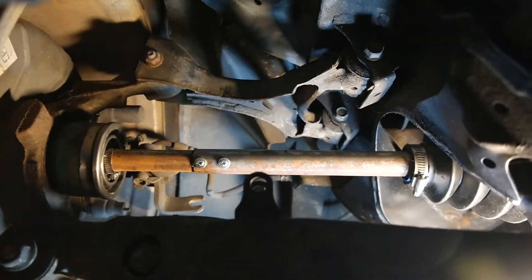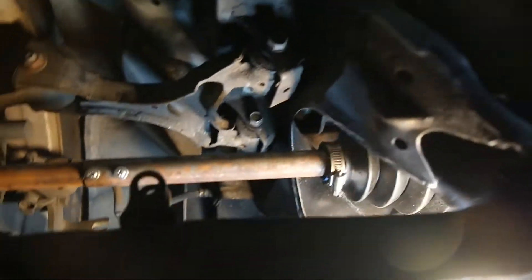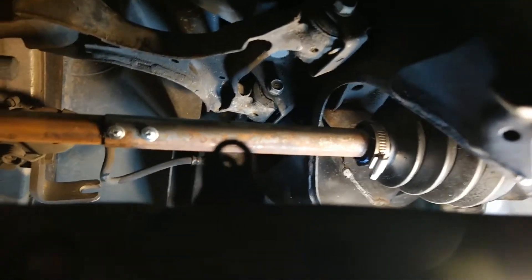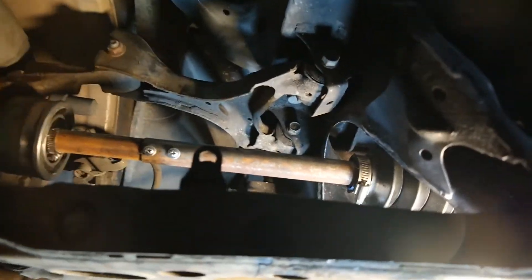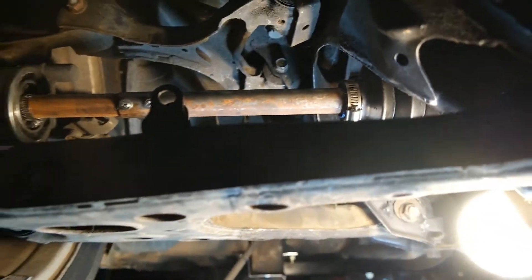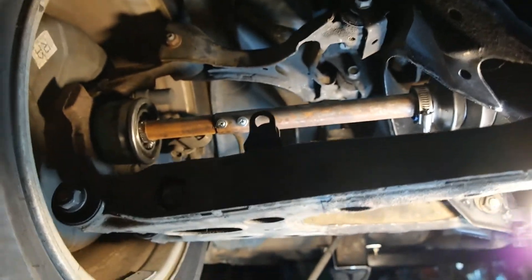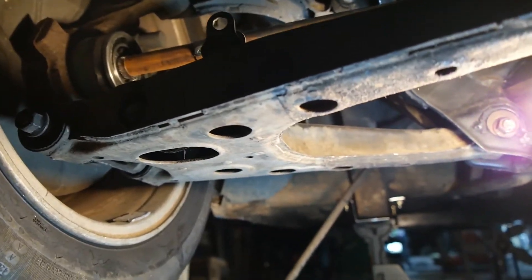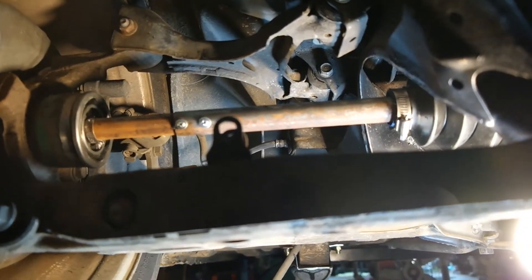Our shaft's in the location we want it. I put a couple self-tappers in to lock it in place, and I think it's going to work out just fine. It has good movement in it and really doesn't compress the inner tripod bearing too much, which is a good thing — the thing has plenty of room to move. So I'm fully confident it'll be fine. Even if we hit a jump or something and the suspension maxed out the other way, I think it'll be fine. It's kind of hard to tell where it would max out without the shock in there, but I think that's going to be fine.